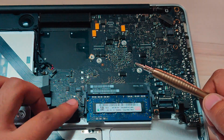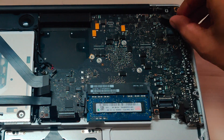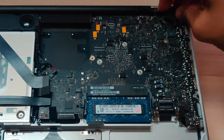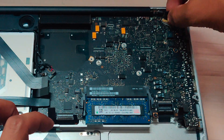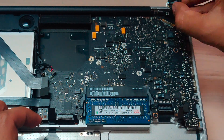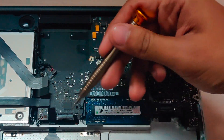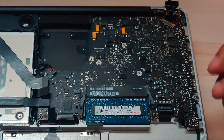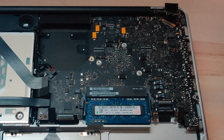This is for the trackpad, keyboard backlit, and the battery indicator on the side. This one is for the LCD display — the display also has the same metallic bridge which you have to pull out before the cable itself. Then unplug it gently; don't hesitate to put a bit of pressure. Then unscrew all of the torx screws — you'll have eight of them, and one has already been removed with the fan.